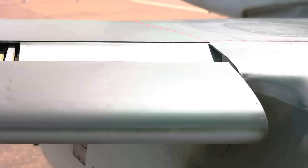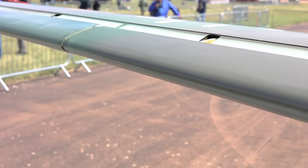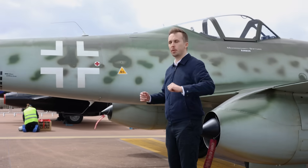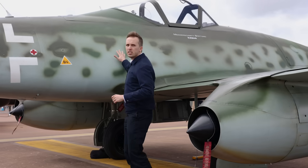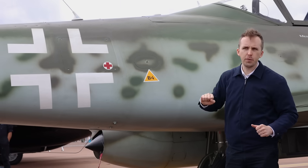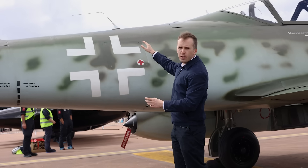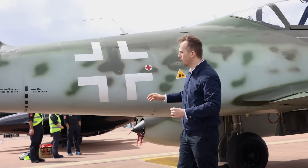Slats here pop out at low airspeeds, increase the wing surface, and provide more docile stalling characteristics. Coming to the wingtip we have navigational lighting and the aileron. Flaps and the engine outtake. A second main fuel tank here of 900 liters. An auxiliary additional fuel tank could also be mounted with 600 liters. We have a motor compass and the radio set in here as well. What you would have here in World War II is the RDF antenna — a loop antenna for radio directional finding.